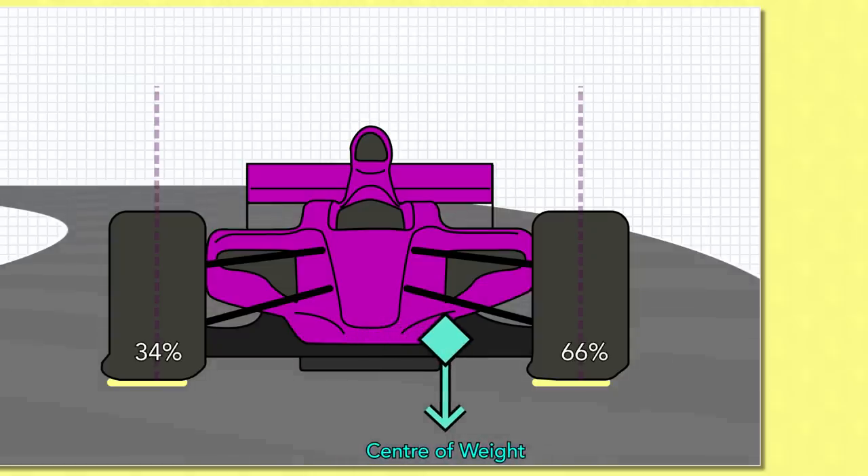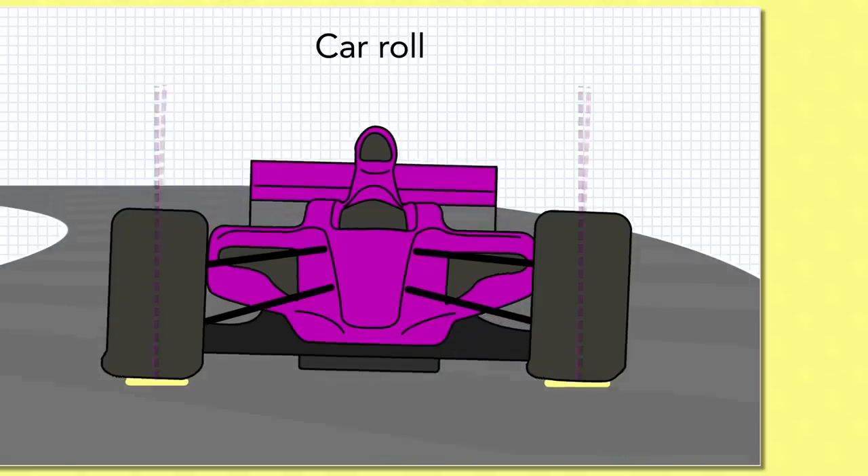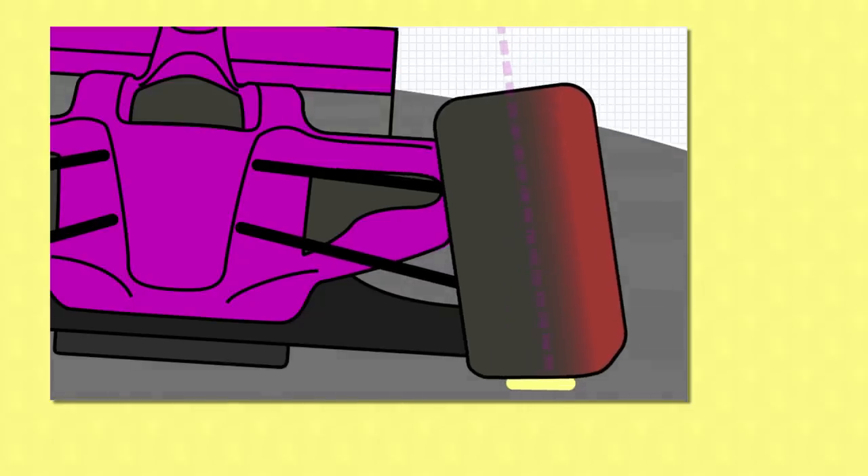Secondly, as the weight swings to the outside of the car, this causes the body to roll — that is, rotate along its length and lean towards the outside. As it does this, it causes the tyre to roll with it. The tyre is now not flat with the track and is bearing the load through one side of the tread. The tread is also being distorted by lateral forces pulling on the rubber, reducing the contact patch further. So with neutral camber we now have that rubber trying to work on a much smaller contact patch, leaning on part of the tyre that shouldn't be overly stressed, leading to excessive wear, unmanageable temperatures, and a resulting loss in grip and speed. If we camber in these tyres instead, the tyre is able to use the full width of its tread much more easily, increasing the contact patch and maximising consistency in traction and grip.